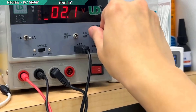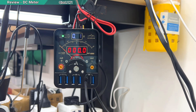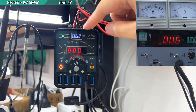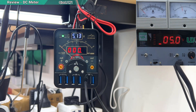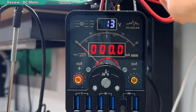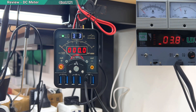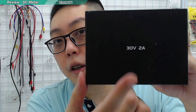I'm going to show how to control it from the power supply. If I raise the voltage — at 0.62V you can see the reading. Continuing to raise it to 5.0V, at that point the little light here starts blinking. If you set it below 5V, say at 3.8V, the green light is stable. These little specs are 30V and 2A.